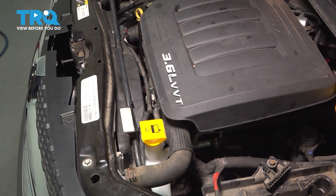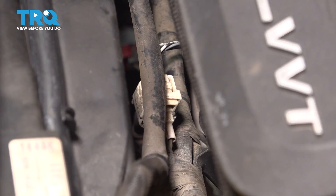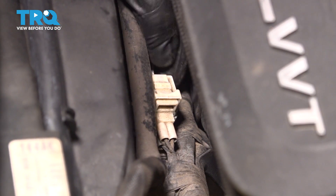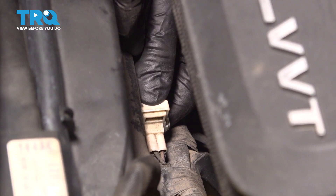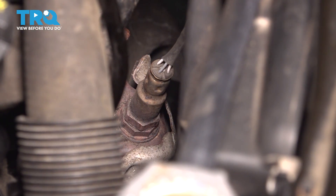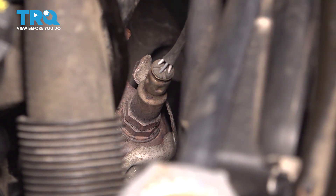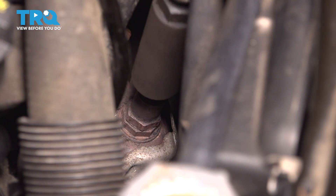In the front of the vehicle, you'll see the upstream O2 sensor — we have to access it from the top. The connector is that little white piece right between your fan and the engine cover. Reach down, pry this wire harness out of the way, press on the tab, and unplug it. You can see the oxygen sensor right from the top. It's easiest to use a tubular-style socket on this one — a crow's foot style can fit, but it'll be more bulky going sideways. The tubular style should fit a lot better.